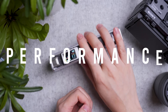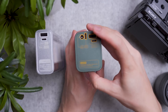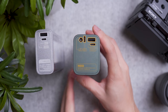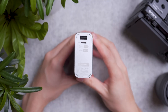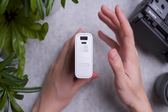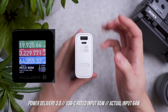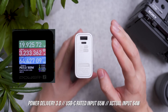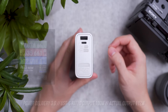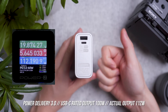On to charging performance. This slim version only has two USB ports, whereas its bigger brother has three — one Type-A, two Type-C, and a DC input/output port as well. Starting with the USB-C port, it supports Power Delivery 3.0 standards for both in and output. The input rated charging speed is 65W — I managed to get 64W, which is close to advertised. The output is rated for 100W and I managed to get even better at 112W, which is 12W more than advertised — a plus point.